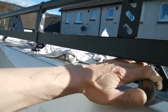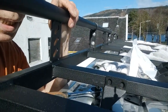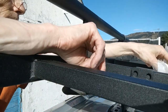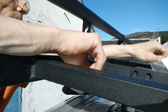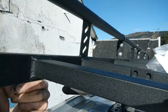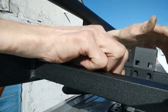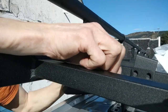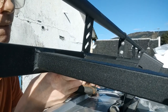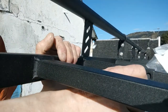You can do these up quite tightly — that's enough. The next job is to put the shackle on this bit here. Having done this bracket up nice and tight, it's time to put the shackle on over the top, and you're supplied with long bolts for this. They go over like that, and what you have to do is lift the roof rack up so the bar is clear and the bolts pass underneath — which is a bit of a weight.